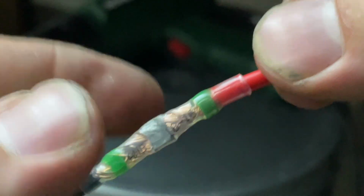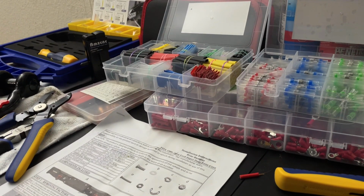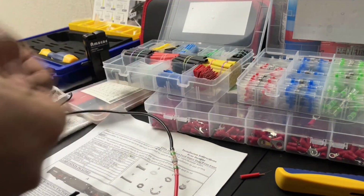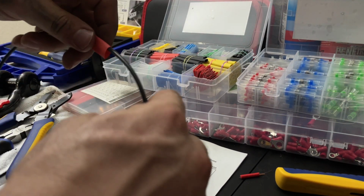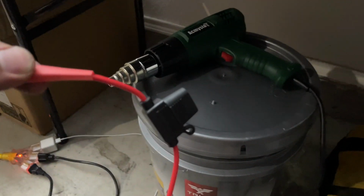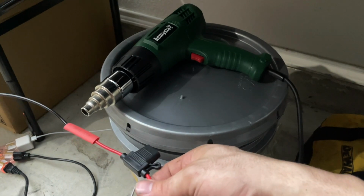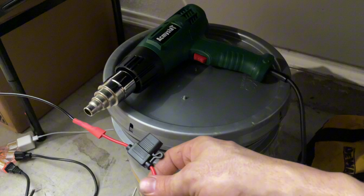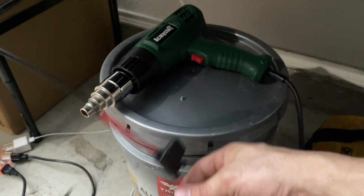You can see these are really useful. They save a lot of time. I mean, this set was not expensive. That one you're looking at, it really saves time, and especially for something like lights, especially audio too. If you're doing audio, you want to have ideally solder connections. Mainly for audio, you know. For something like lights, it's not as crucial, but just so you don't have to go chasing, do it right once, cry once, you know. So down the road, if you have issues, God willing, you won't have issues, but if you do, you'll feel pretty confident in how you do it. That looks good.